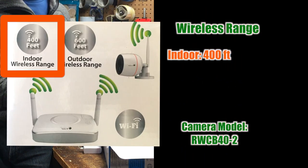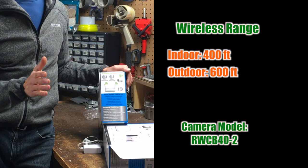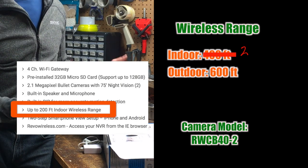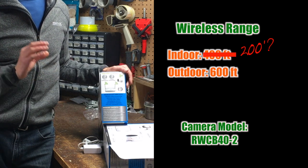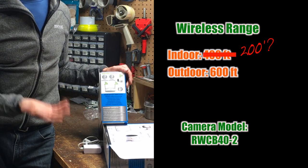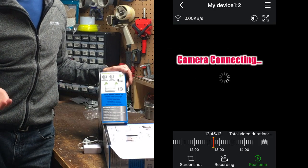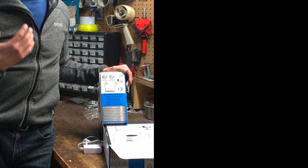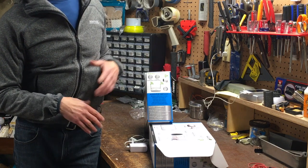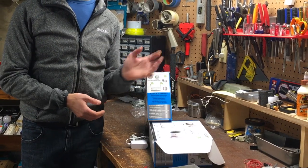Also, keep in mind that infrared at night does not work through windows and nearby objects from outside lighting can mess with the image. According to the packaging, indoor wireless range is 400 feet and outdoor wireless range is 600 feet. According to the manufacturer's website, it states indoor wireless range is 200 feet — not 400 feet. I'm going with the manufacturer's website and I think 200 feet is actually generous given my experience — I've had connectivity issues from 60 feet away from the gateway. I'm using a 2.4 gigahertz router. The only way wireless range would be 400 indoor and 600 feet outdoor would be in an open field or maybe a house with no walls, doors, or windows.